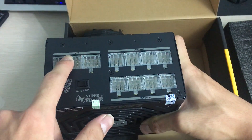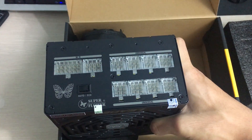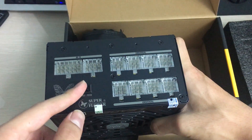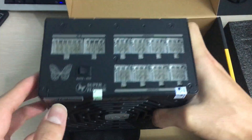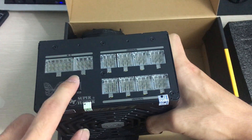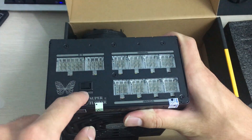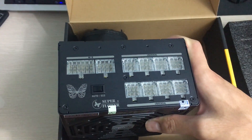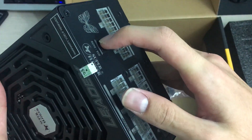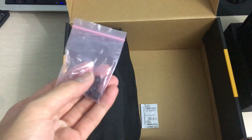There are also white LEDs behind the modular connectors that light up once you plug something in, which is a nice bonus. There's also an auto/eco button for fan control — I wish it were accessible from outside, but I actually recommend leaving it on auto. Keeping the fan running keeps it cooler and makes the capacitors last much longer than passive mode, which saves very little noise since on idle or low loads the fan doesn't spin fast enough to hear anyway.